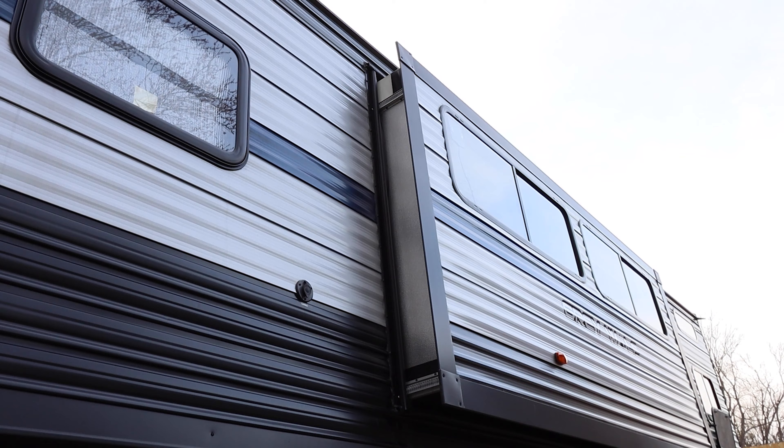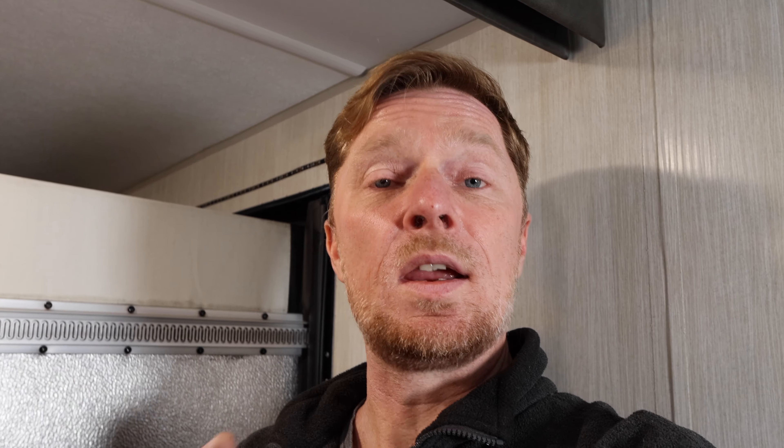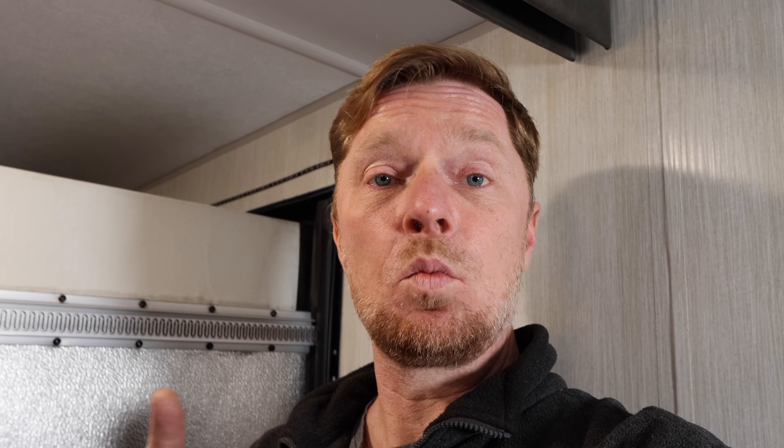There are little guide wheels under here — the bottom of the slide-out actually runs on those guide wheels. You can't really see them because they're tucked up behind the seals, but I'll also take some of that seal lubricant and spray those down as well. Those little wheels roll up underneath and ride on the bottom of the slide-out, so we want to make sure they stay moving and lubricated. Now that we've got all the seals on the outside done, we need to do a few items on the inside, so let's close the slide-out and go look at those.